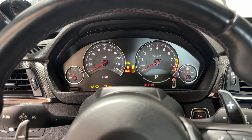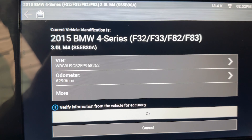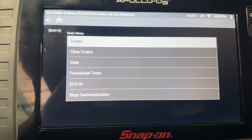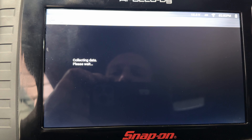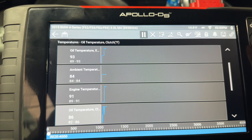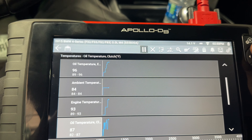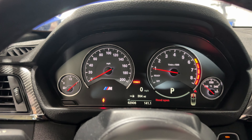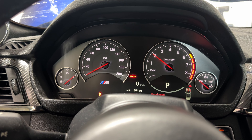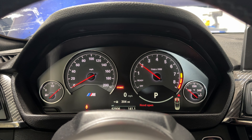We're in the car now. While it's warming up, we'll get the vehicle information loaded so we can pull up the transmission temperature. We have different temperature readings available: control unit, engine temperature, oil temperature, the clutches, and temperature sensors one and two — all in Fahrenheit, but we can switch to Celsius. Now that we're monitoring the oil temperature, we hold it at 2000 rpm for one minute while still monitoring the temperature.